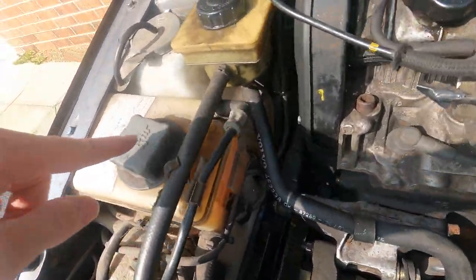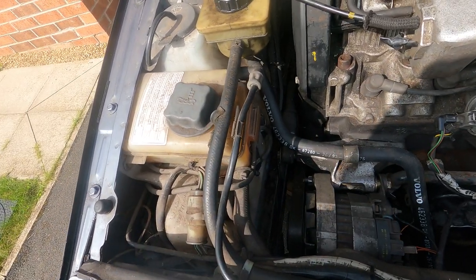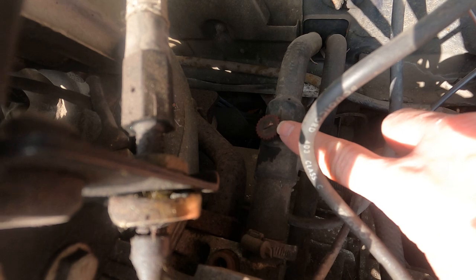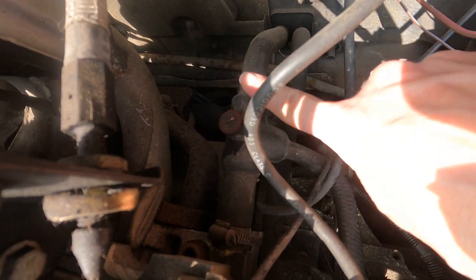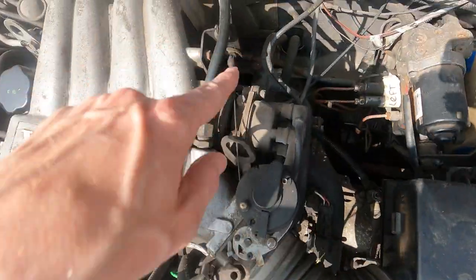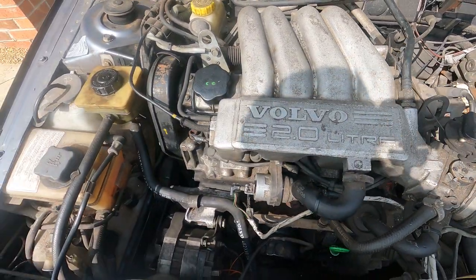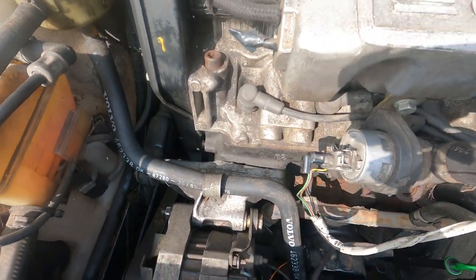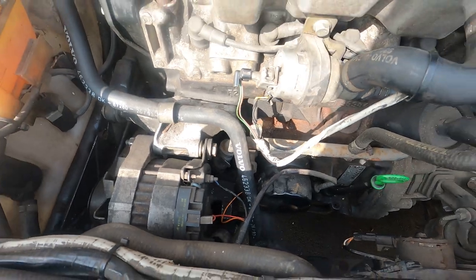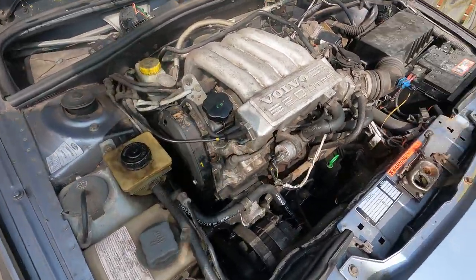The main one that I've been looking at is the engine. What I did earlier on is I've filled the coolant back up again. When I had the coolant pump off I obviously lost quite a bit of water and also got air in the system. So I filled the coolant up — you can see just there that is the bleed screw; it's attached onto the internal heater matrix. I undid that and was getting air out of there. I ran that for a while, also pumped the radiator hose down the bottom, and when coolant started coming out it looks like we've got a full system. You'll notice the spark plugs are back on — put those in, torqued them up — and I also checked the oil. I replaced the oil a while back and checked the dipstick; it looks nice and clean and all good. I'm quite happy with that.